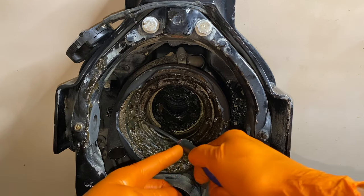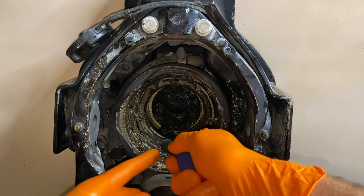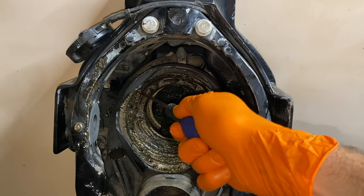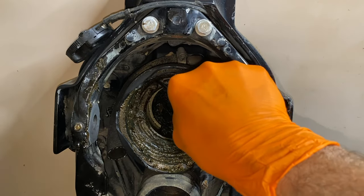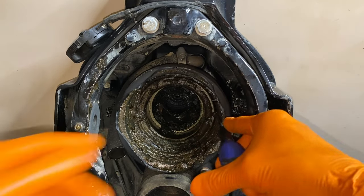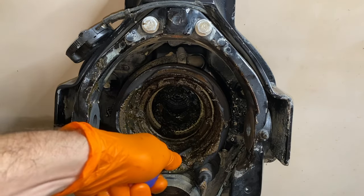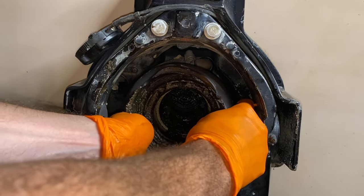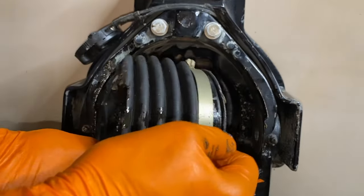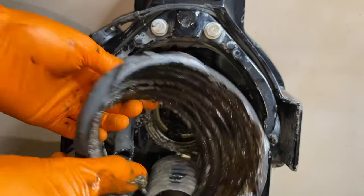Pull the entire bell housing out and set it in a safe location. Now with a very fine tip flathead screwdriver, carefully put it in between the bellows and housing to start loosening the adhesive and push the bellow off the housing. Be careful not to scratch or gouge the inner housing where the bellow mates — that would lead to all kinds of trouble. Doing a full circle around, separating the bellow from the housing by breaking away the adhesive. Pull it off carefully. Set that aside.